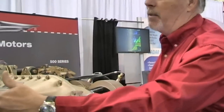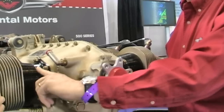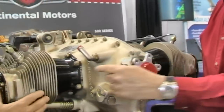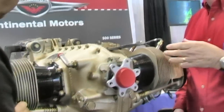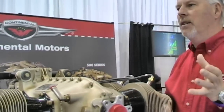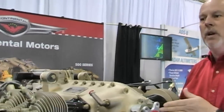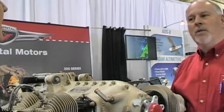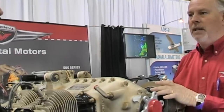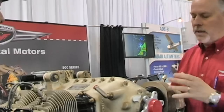Externally, the crankshaft, the tapered fins on the cylinders — which actually derive from the 550 big bore — you can see the fins are tapered, not straight. When we did the 550, there was a lot of analysis done that realized we didn't build as much temperature in the lower end of the barrel, so we could take material out. In the big bores that was about seven pounds — not as much here, but we were after ounces to eventually get pounds.